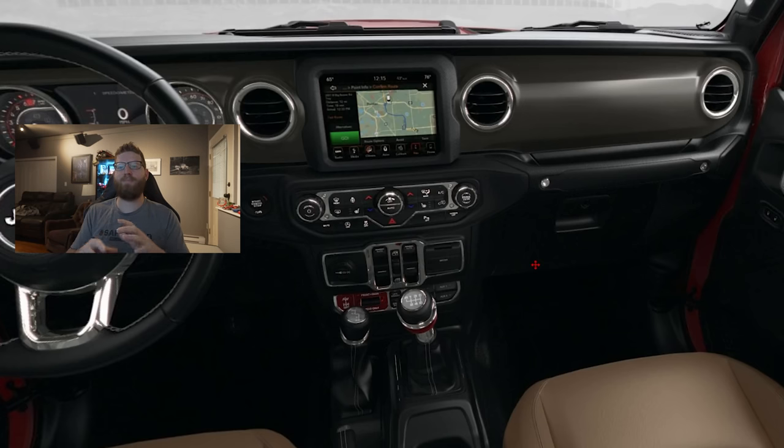The part that most people don't know — and I didn't even know when I ordered my Jeep — is that you actually get two more wires on the interior. These are lower-amp wires, but one is always on and the other is automatically toggled with your vehicle's ignition. So if you want to run a dash cam — and why wouldn't you want to run a dash cam in today's age? They can save you from so many problems in an accident, or I use mine to capture shots while off-roading. Most dash cams need both a switched power and an always-on power — you can just connect them right up to these two wires under your dash.